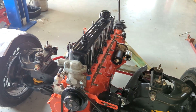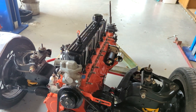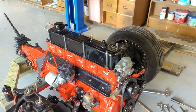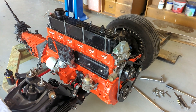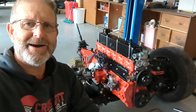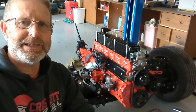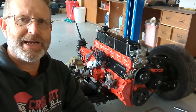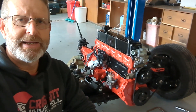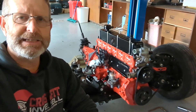I've got to pick up a coil mount off a mate — I haven't got a coil mount to mount that coil on there yet. Then I'll start working on cleaning up the manifold and the extractors and get them mounted on, and then we're pretty much good to slip it back up in the car. I could slip it in now but I really want as much on as possible before I slide it in. I still need to tighten up that thermostat housing, put some gasket glue on the gasket, and seal that up.